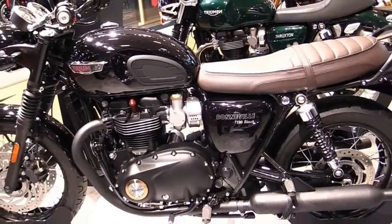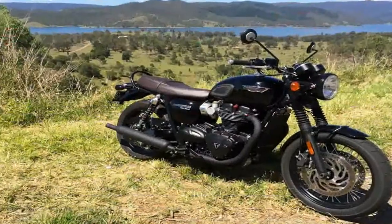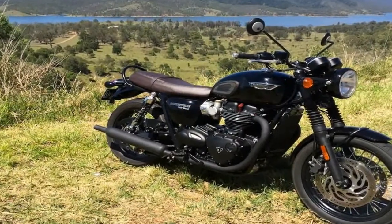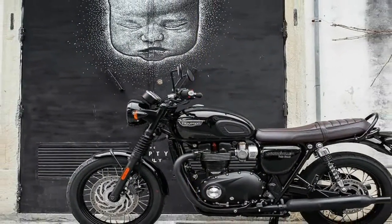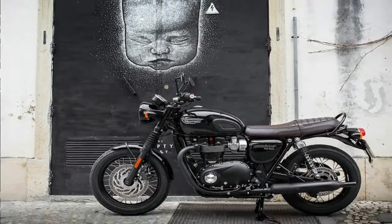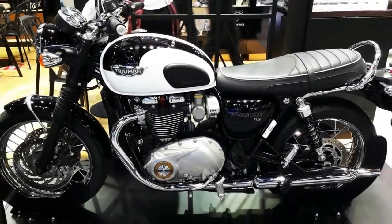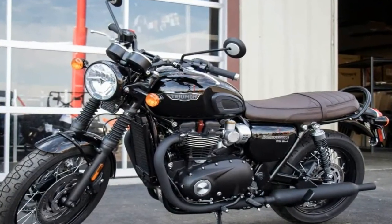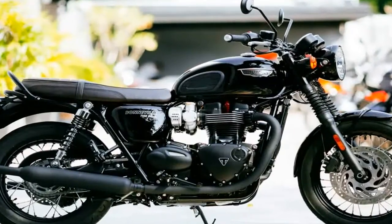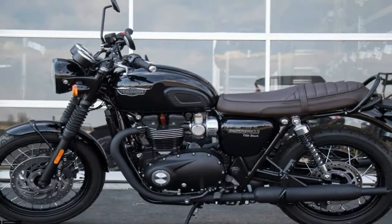Fully loaded with Fuel Plus Rider, the bike's weight can get pretty heavy, but the factory gave us plenty of brakes to work with. All-around twin piston Nissin calipers bind the dual 310mm front discs and 255mm rear disc for almost sports bike-like stopping power. ABS protection comes as part of the stock equipment package, so you can make the most of all this braking power with confidence.